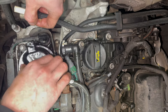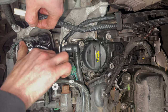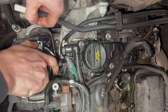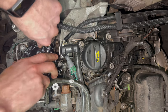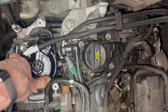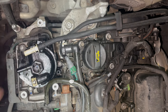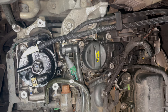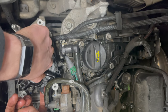The housing doesn't have a torque figure — you just need to wind it back in until it meets the plastic stop and returns to the position it was in before. Obviously don't over-tighten it, there is no need to. You can add a little bit of lubrication to the o-ring if you think it is a little tight when refitting.